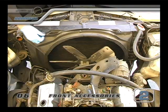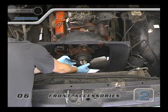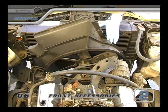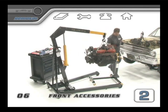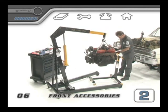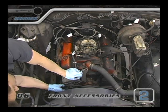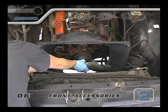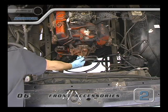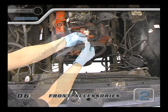Every car is different. On one of ours, we weren't able to remove the fan shroud before the fan was out, so we just laid it aside. But on the other car, it just needed to be turned upside down and it slid right out. If you're planning on leaving the transmission in the chassis and pulling the engine out by itself, you should be able to leave most of the accessories attached to the front of the block. If you're concerned about room, or you're going to leave the transmission attached to the block, you'll want to remove as many of the front accessories as you can. If this is the case, start with the fan. To pull it out, you'll have to loosen all the accessories with belts on them and place the fan shroud out of the way. Then you can pull the fan belts and tape them together in the same order that they came off the car, so you can remember how to put them back later if they're reusable.